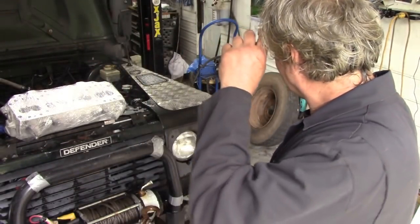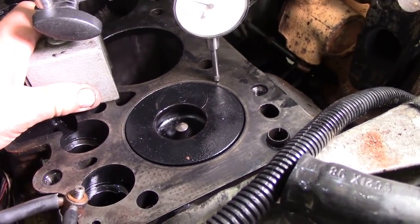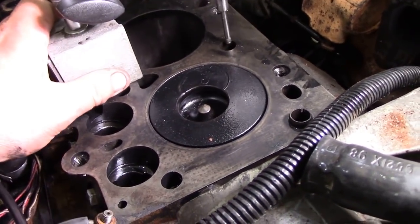It's funny, isn't it? Britpart one's a bit stronger. Right, less of this rambling. Let's get on. I'm just checking the height of the pistons and averaging them out. And it seems to be around about 25 thousandths of an inch on every one, 25, 27.